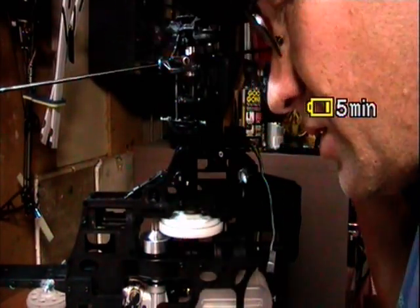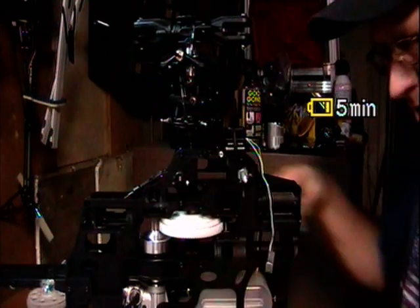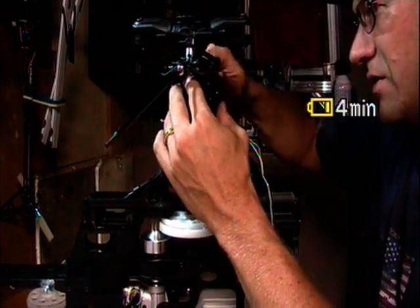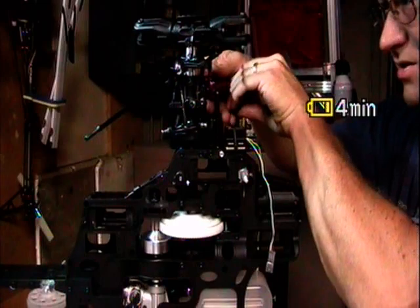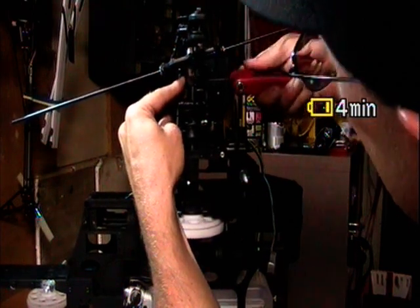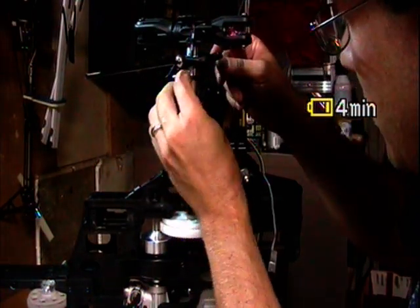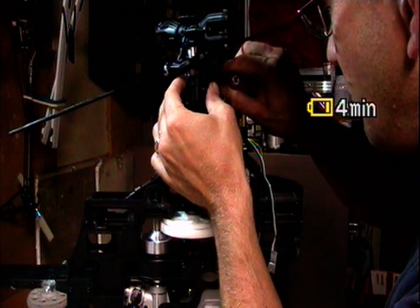Go ahead and stick this in here — you want to get that worked in and line it up with the shaft. There's a hole in the shaft and you'll have to get a tool in there to make sure it's lined up straight. Sometimes it'll just pop right in, sometimes you have to give it a good twist with the allen tool to get it in place. One side will have the indention for the lock nut, which is quite handy, so that'll pretty much work into place as the bolt comes through on the other side.